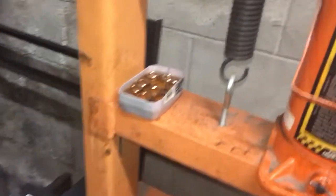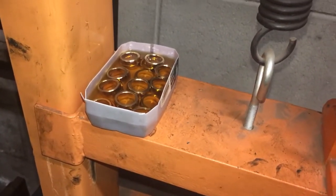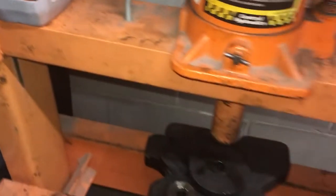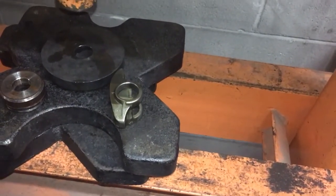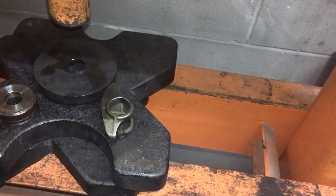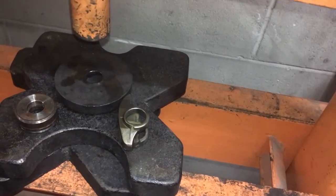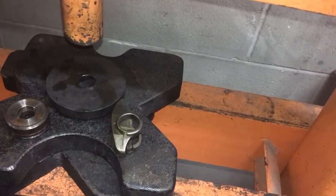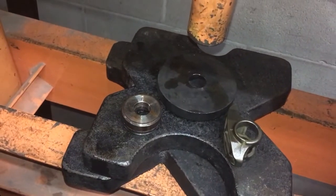What I've done is take those bronze bushings and have them soaking in motor oil. Then basically what I do is take a rocker arm body, press in one bushing on all of these rocker arms on the bottom. Then I use my center trunnion and my secondary bushing and use that little piece as a spacer.